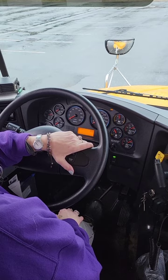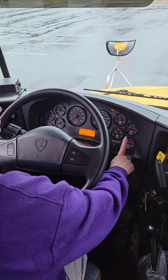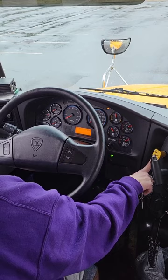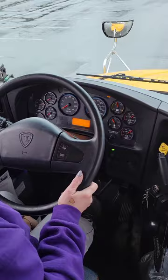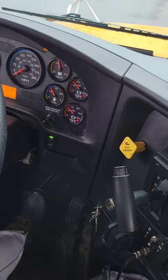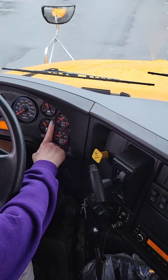Now I'm going to pump the brake. My low air warning light and buzzer should come on at or above 60. Then I'm going to continue to pump it, and my parking brake should pop between 20 and 40. Make sure to tell the examiner when both of those things happen. If you want to stop when your light and buzzer come on, you can do so. It came on about 70. I'm going to continue to pump. My brake popped just above 30. The gauge still moved when I stopped pumping because my foot was moving faster than the gauge.